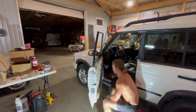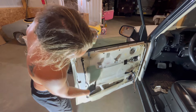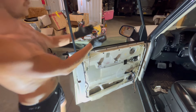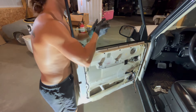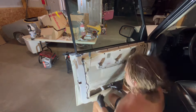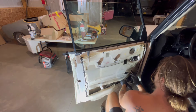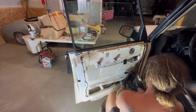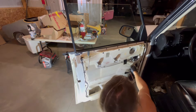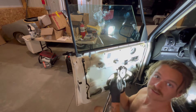It's driving me nuts so I'm going to take that motor out. You've got to pull this screw right here and then these three, and then that whole piece will drop out. But you've got to take the window apart first so you can pull the window up and out of the way. There are actually four bolts that hold this motor in. Once you get those loose you can reach the plug in here. Boom - that's how you get the regulator out.